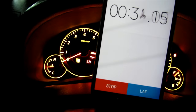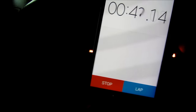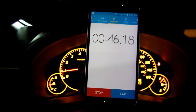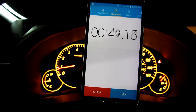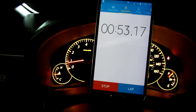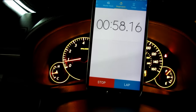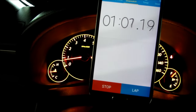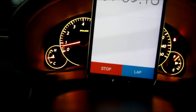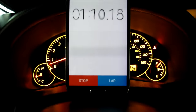As soon as the check engine light turns solid, let go of the accelerator and turn the car on for at least 20 seconds. When the car is on, let it rev a couple of times to make sure the idle is right. Give it a couple revs — this is how you complete the idle relearn.